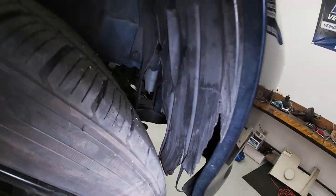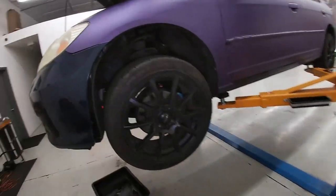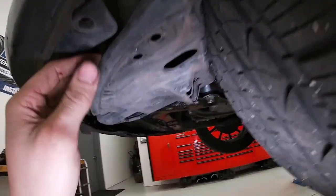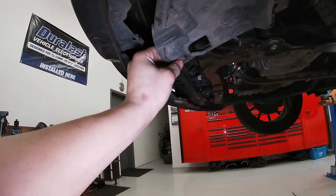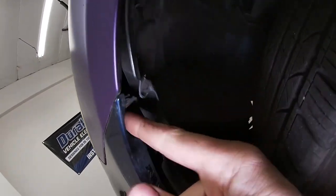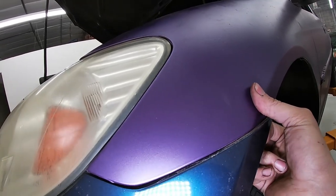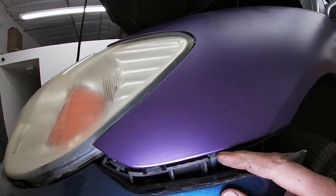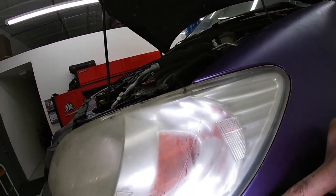They pop out pretty firmly. On this side I have the 8 millimeter screw out and it has a little bit more of the fender liner so I can show you. It also had one of those big pop clips and a screw that goes in right there — that screw was missing on this one, so we'll put one back in. Once you have your screw out, just kind of pull out on it gently and it just pops out. You can see down in there — those teeth on that bracket are what snap up into portions of the bumper to keep it on.